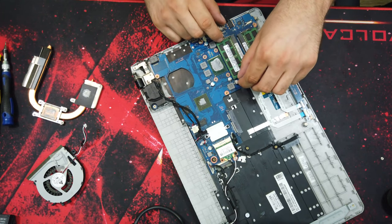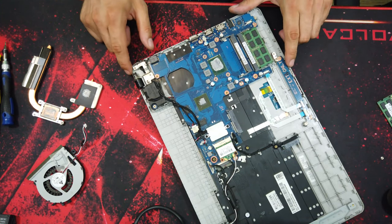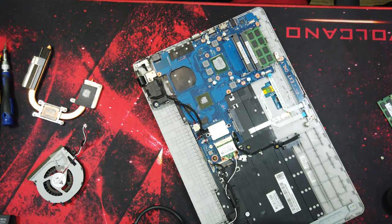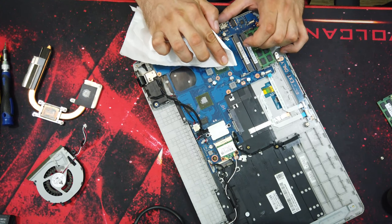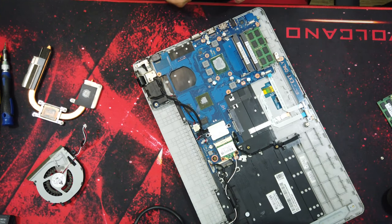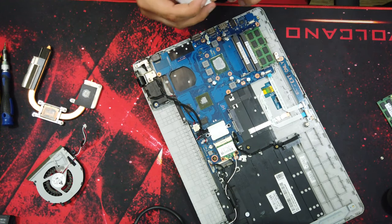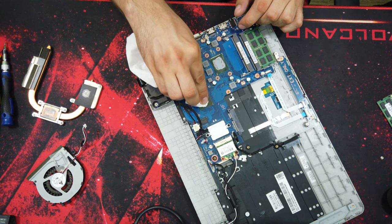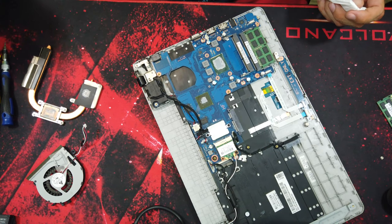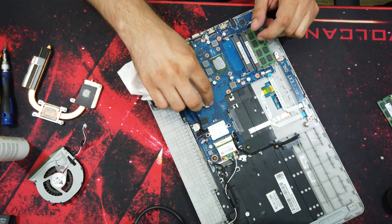The most important thing is to remove the old paste before applying new one, and I'm saying this because I've already seen 2 layers of paste on a CPU, and that's not good. And for cleaning old thermal paste, I recommend isopropyl alcohol, some towels, and cotton buds.